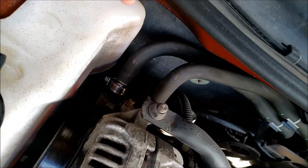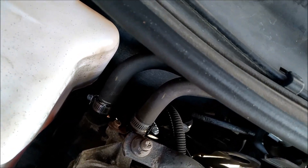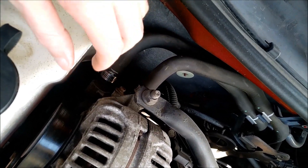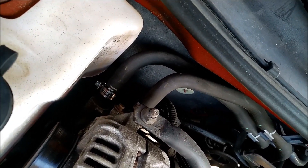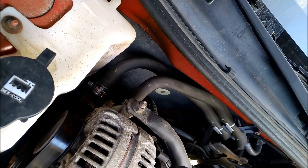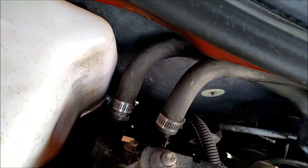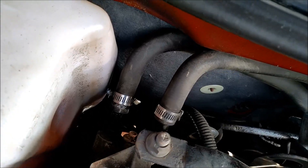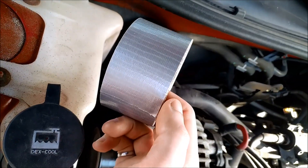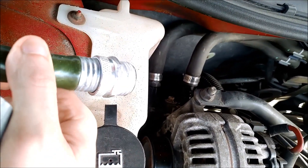To do this job you're gonna need to disconnect these hoses. They're held on with flathead screw hose clamps, so you'll need a flathead screwdriver long enough to reach down there. You can remove them by hand with gloves, or use vise grips. Put some catch trays down on the driveway because it's gonna leak all over the place. Once your hoses are disconnected — they're just resting on the spigots, fully disconnected — we're gonna rip a page right out of the Red Green Show and literally just duct tape the hoses together.